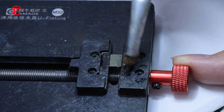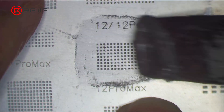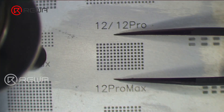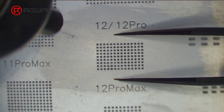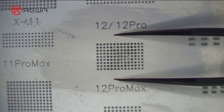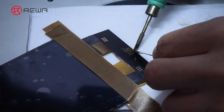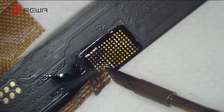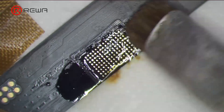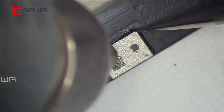Then clean with PCB cleaner. As the bonding pads are clean, apply a layer of solder paste evenly to the bonding pads. Form the solder balls with a hot air gun at 260 degrees Celsius. Then clean the bonding pads on the flex cable, using a soldering iron at 380 degrees Celsius and desoldering braid to remove tin. Solder the IC with a hot air gun at 280 degrees Celsius and airflow 2.